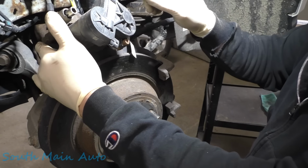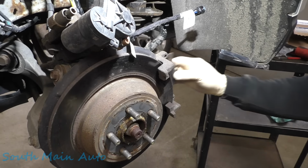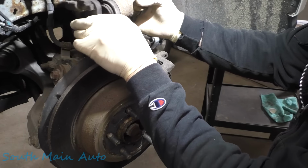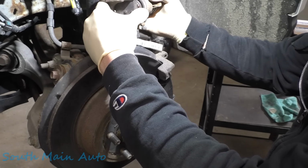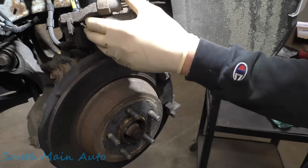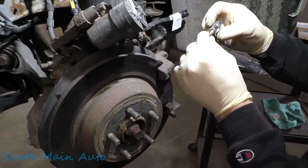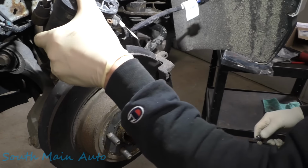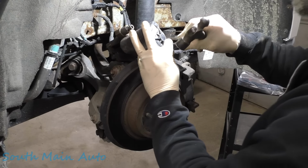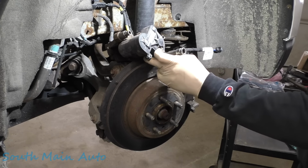And then we need to go get whatever Torx bit fits those. Drop our inner pad back in there. Let's make sure this outer one's probably stuck on there. Yep, we'll leave that right alone. Got another Torx bit with us. Let's see, is this the right one? Whoa, way too big, fella. That's a 40. These look like probably a 30 if I was a gambling man. See if we can make a T30 fit. Fits perfect.